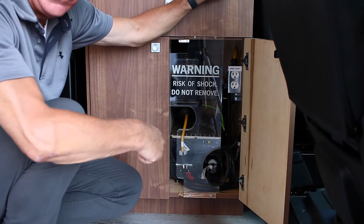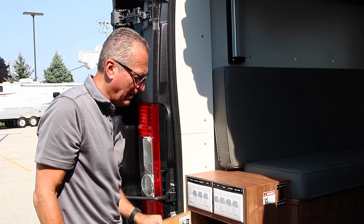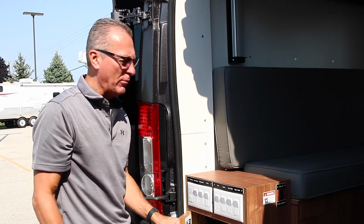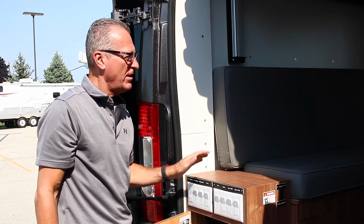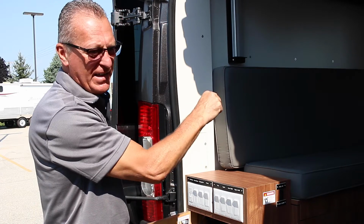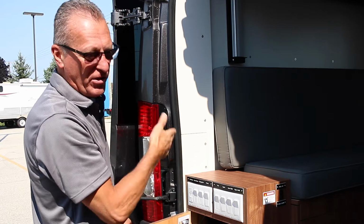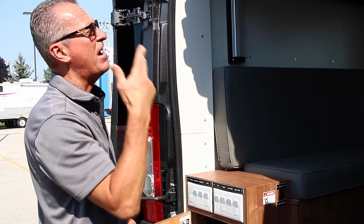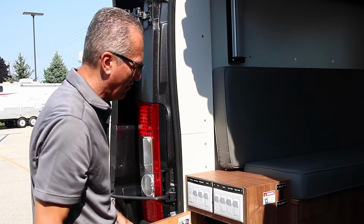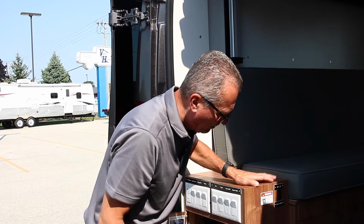Leave the van running and it'll charge that battery back up. So this is a solar inverter in the back of the vehicle. We've got two 100 watt solar panels up on the roof. They feed power into this, but we also have that front inverter plugged into the inverter for the back one here. So if power is needed back here, because you're in a cloudy area and you need charging, that'll send power back here to keep this one fully charged at all times. Otherwise, the sun usually is enough to keep it up.